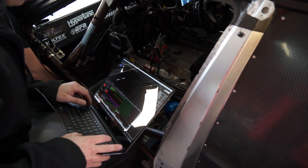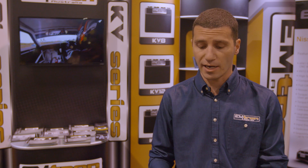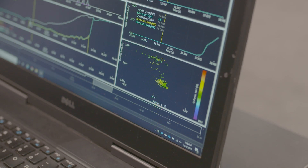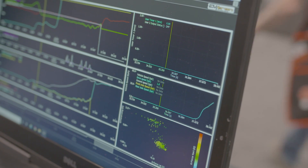Another important feature of the software is its ability to calculate channels that are very useful, where you don't need any third-party software. With programmed gear ratios, rear axle ratios, and tire sizes, you can actually calculate input shaft speed, output shaft speed, clutch slip, converter slip, and those kinds of channels, which are very useful.